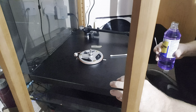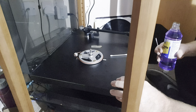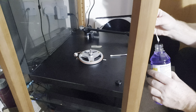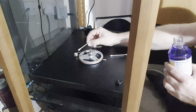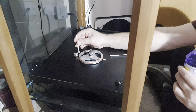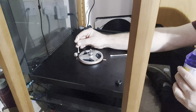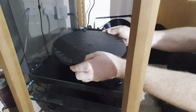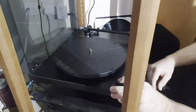I've put my turntable back into place and plugged it in — when I switch it on it works. Before putting the platter back and playing a record, I'm using a Q-tip and some meths to clean the pulleys and the subplatter surface, and if you've been handling it give the belt a clean too — make sure you haven't got any grease from your fingers on it. Allow that to dry and put your platter back. That startup is a big improvement on what it was. Happy listening! If you've got value from this video, please support the channel by liking and sharing it.